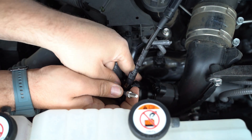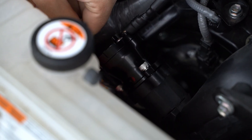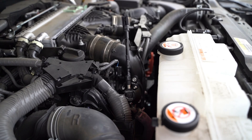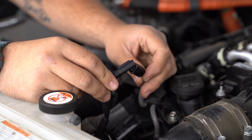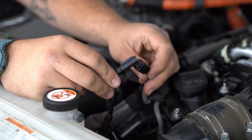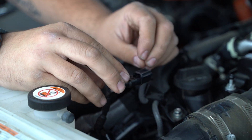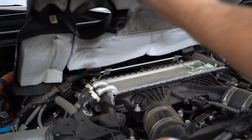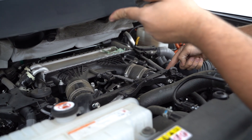Now you're able to install the secondary EM unit on the right side of the vehicle. Make note of the orientation of the solenoid on the EM valve. Once the compact EM unit is installed on the right-hand side, take the new solenoid and OEM harness and connect them. When installing the engine cover, make sure you align the two bushings in the rear, then push the front down on the two standoffs.